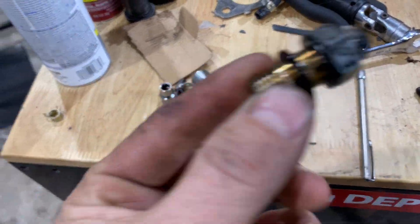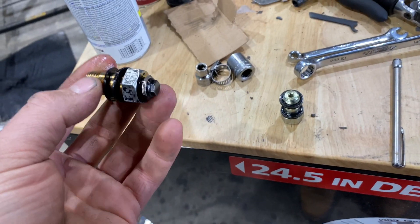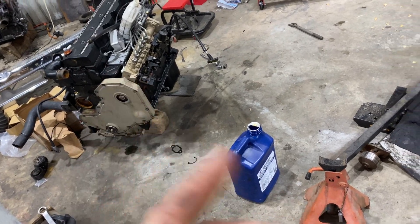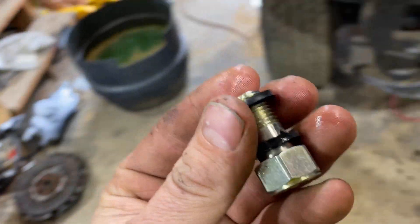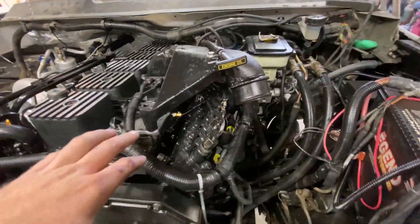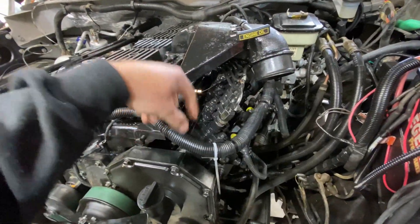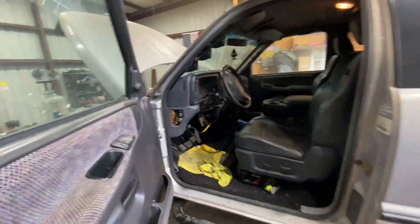To elaborate: this one's got an adjustment on the back side. Just talking to Roland — he said this one's not going to take it down that far, and for daily driving, 90 PSI is way too much. This valve wasn't ever on that engine because he says you'll burn up a pump by having too much pressure for daily driving — unless it's a hot rod. So I bought this valve and also a stock replacement at the same time. I'm going to throw the stock one on there and see what pressure we're at. That is the return line right there — you want a check ball in that so when you shut off the fuel pump, it holds pressure from back-draining. The pump holds pressure on its own end from going back into the tank, and this holds it on the back half so you don't have a dry pump when you start it up. So if you're hard-starting, that check ball I just swapped out could be the case.